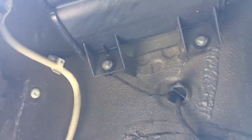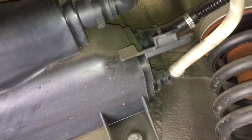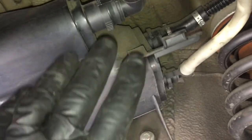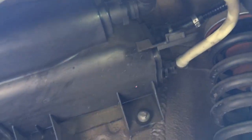There are two tangs right at the top — it's just hooked up behind that bit of steel there, so it'll sort of twist out as it comes out. And don't be an idiot when you're working around here — don't be doing it with a cigarette on the go or anything like that, because there's a chance of fuel vapors coming out of these hoses. Just think about what you're doing.